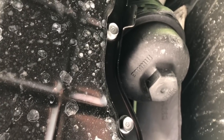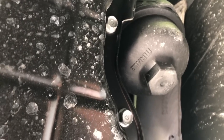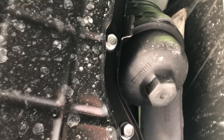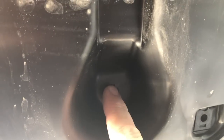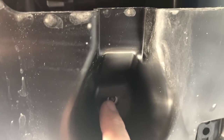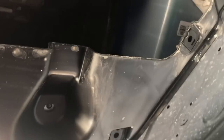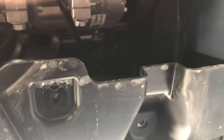That's generally a good rule of thumb with any oil filter — they just need to be a good hand tight. You don't need to wrench it down hard. One other thing: I did not realize there was an extra bolt in here. After I got all those bolts disconnected it was still firmly attached, so I located that extra bolt. You actually have five bolts that need to be removed in the front and two in the back.